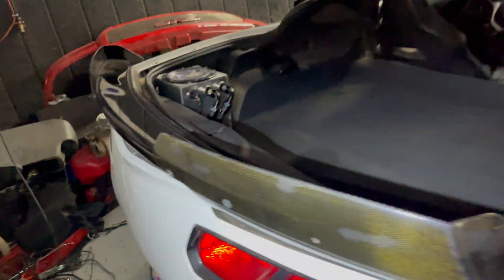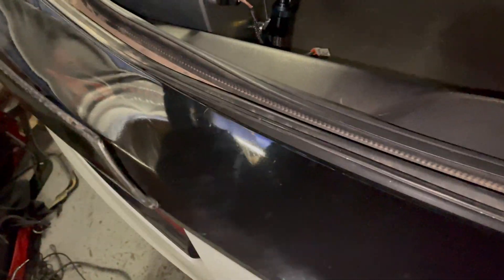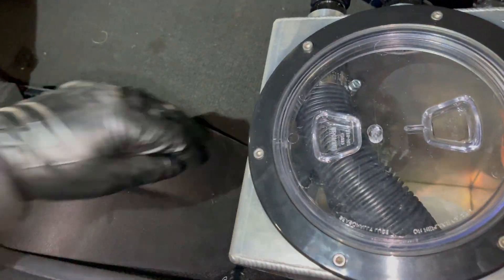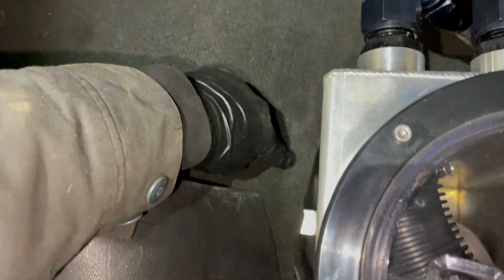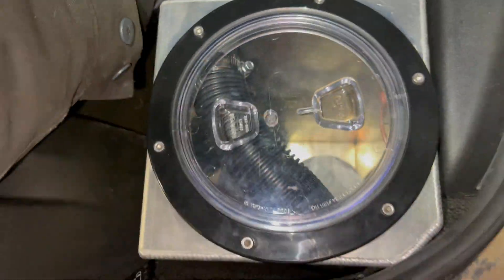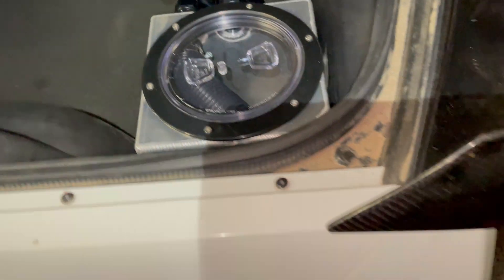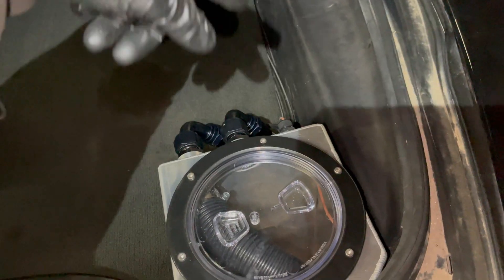You can't even see the lines on this portion, so we'll have them tucked down below the battery — that way if we ever need to service the battery it can come out. The pro speed tank sits over here on this side and bolts in. I put some rivets underneath the carpet for the mounting point, and it sits nice and flush in the corner. You can see it's got the pump inside, two dash-12 lines coming off, and we have the drain going down underneath the vehicle.